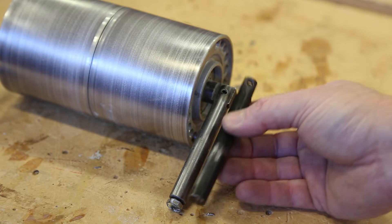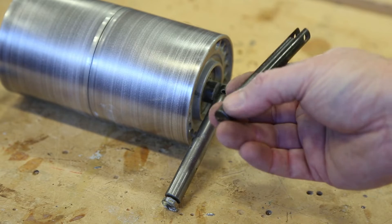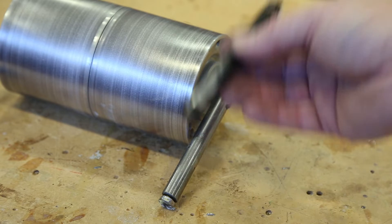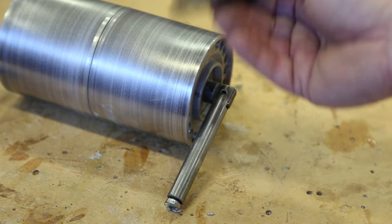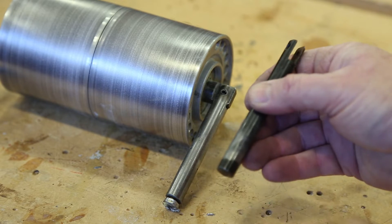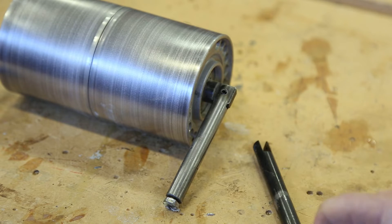Now this is the original arm here, and as you can see it's a little bit longer than what I have now. I'm not a big fan of modifying the original — you could take the original one and drill it out, which is what I did here with a bolt, but I built a new one. That way I've always got the original part. I'm always a believer that you could modify this but then it's modified forever. So I needed to shrink it down a little bit. You could cut it, but it needs to be right on the money or else your belt could be too loose or still too tight. With the adjuster, it worked out perfect.